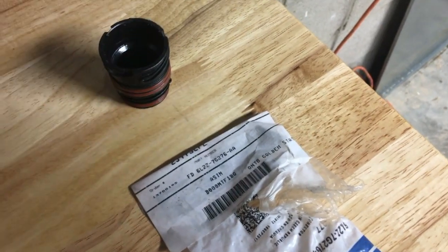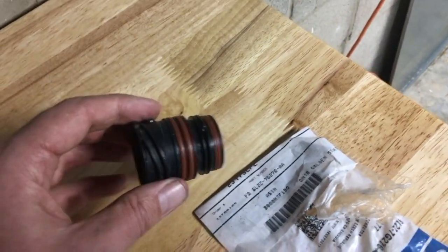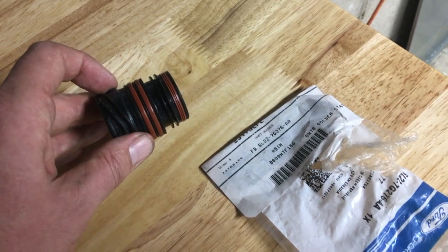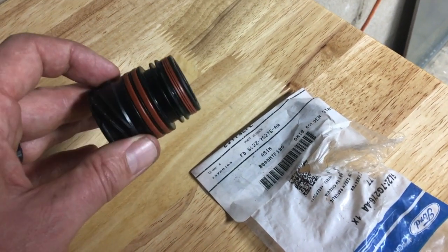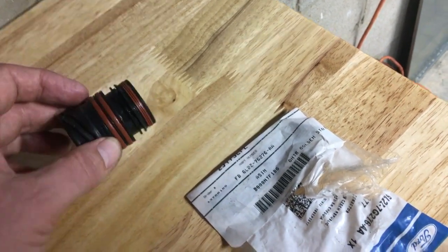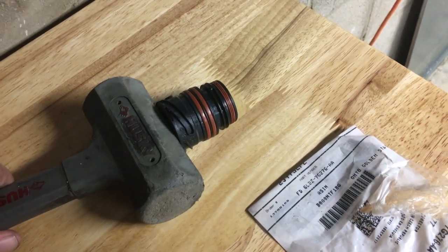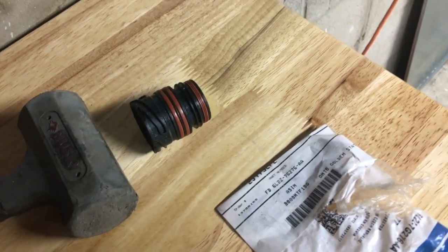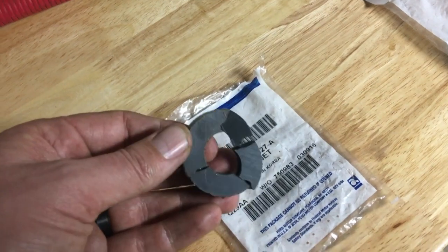It came out no problem — drop the pan and there's a little white plastic lip you pull down and it slides right out. On the new part, even though it's an identical part, it has healthy o-rings so there's a lot more resistance to put it into place. After much trial and error and reading numerous comments on different videos with other people struggling with the same thing: give it a healthy coating of transmission fluid all the way around to really lubricate the seals, then gently apply pressure. I didn't whack it with a hammer but gently pushed on it while wiggling the white clip into place — after a little bit of fooling around it clipped right in.